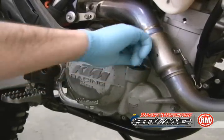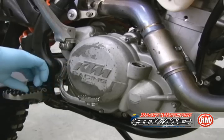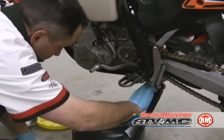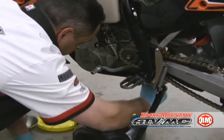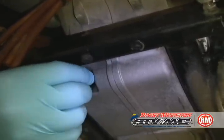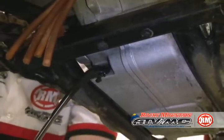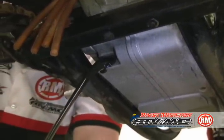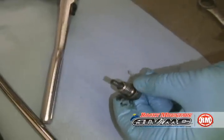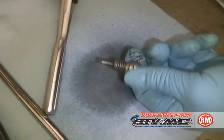We're going to go ahead and take off the filler plug and then go right to the drain plug. It's located on the back end of the engine — it's actually horizontally mounted. It's a 13 millimeter head. This plug lets most of the oil out. It's also a magnetic drain plug, so make sure while that's draining you clean it up — take a little contact cleaner and spray it off. Make sure you get all the metal particles off.